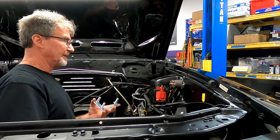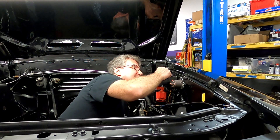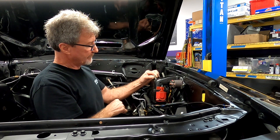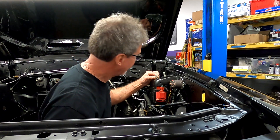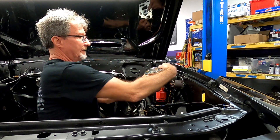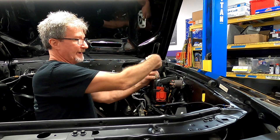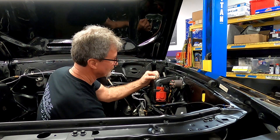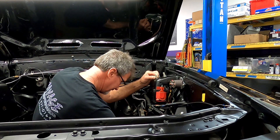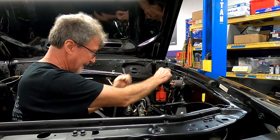I'm going to try to do this without scratching it since we painted this up real nice. I'm basically going to start by putting the studs dead center of these slotted holes. From the factory, the two front holes are slotted so you can adjust the camber. I always put them pretty much dead center, because you still have plenty of adjustability on the plate for camber in and out, and the plate adjusts caster front to back.